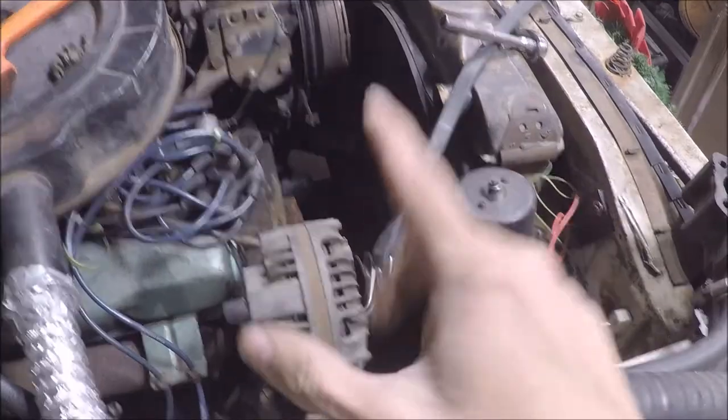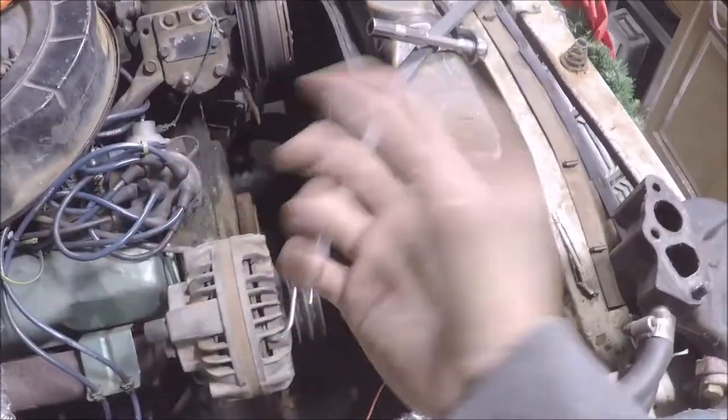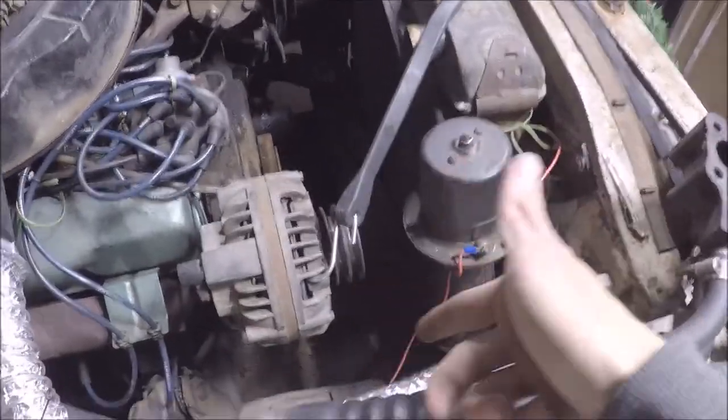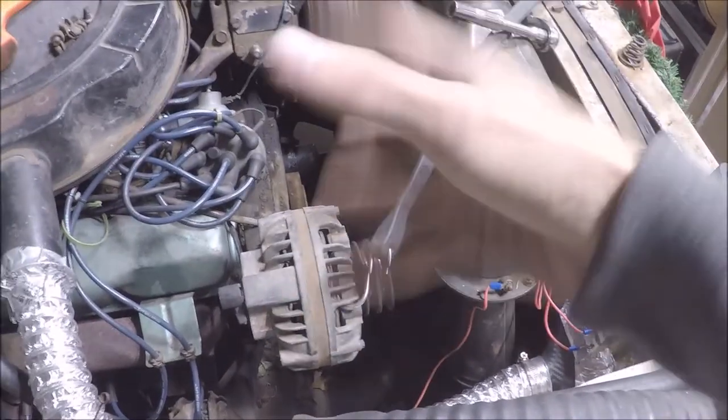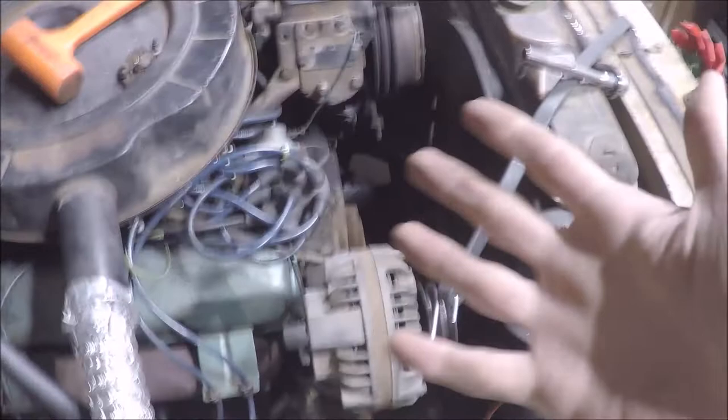So I think either the radiator comes out, or I have a really dastardly plan of getting that bolt out. The dastardly plan I have in mind with the cheater bar is I'll put the socket on with the cheater bar and then wedge it up against something that will not move. Then when I crank the motor, the crank will turn, but it'll unbolt the crank bolt as I'm cranking the engine. See what I mean?